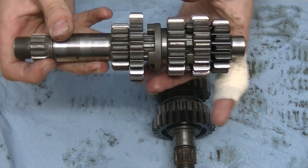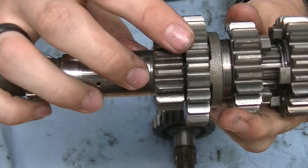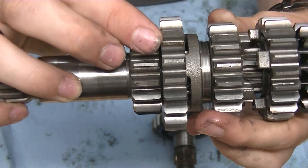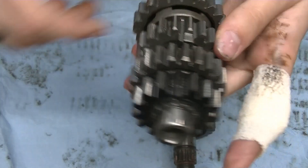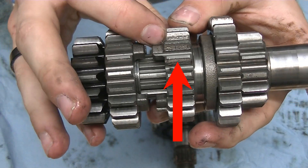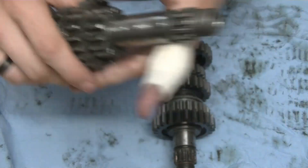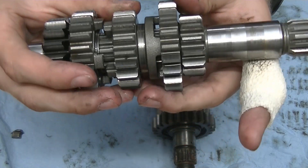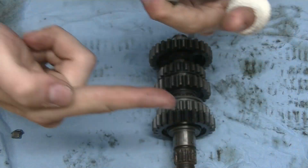The first thing when you're inspecting a transmission for wear is you want to look at all the teeth on the gears. This first gear — you can see no huge damage marks, there's a little bit of rust right here. Now we move on to this gear here, and if I flip it around for you guys, see those big marks on them right here? Those are wear marks — and these are not just regular wear marks. These are wear marks from that chunk of the transmission that I found floating around in the crankcase. So this gear clearly would need to be replaced, and I'll put the price of that gear right here on the screen.